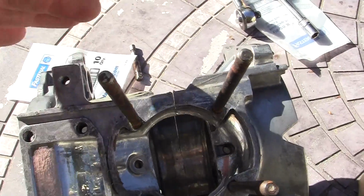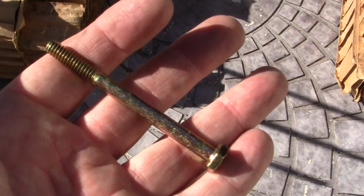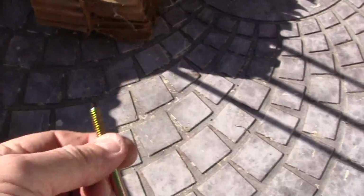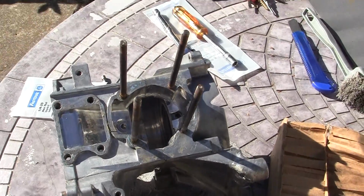And the way I do that is I'll take this apart and we'll put the dummy bearings in, and then I'll put the crank in, and then I'll put these back on and see if I still have good movement. And that way I can dry test my fitting before I do the final fitting.